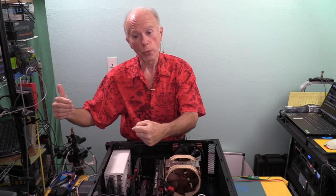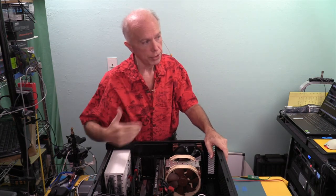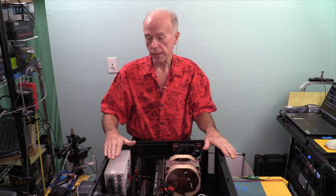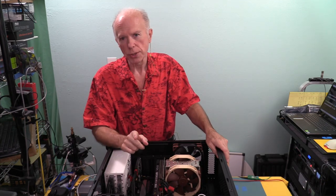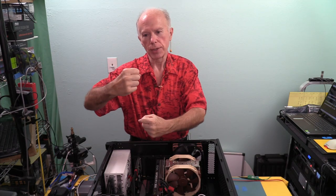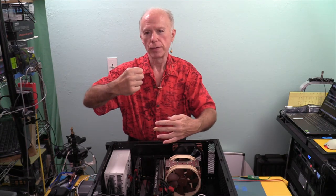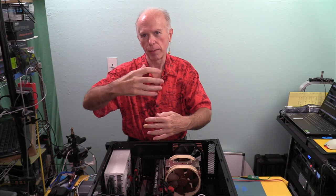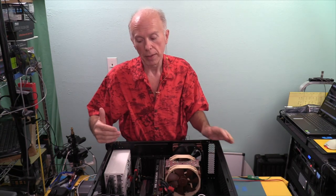We need to figure out which USB-C 20 gigabit ports are connected to which chipset. This is relevant for anyone looking to build a machine like this as a DAW — digital audio workstation. Which interface are you going to use? The number one requirement for a DAW is low latency. If four lanes connect chipset two to chipset one, then something connected to chipset two is going to have higher latency than something connected directly to chipset one, which connects to the CPU. That's my theory.